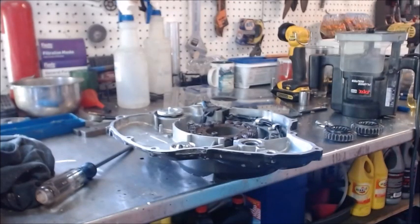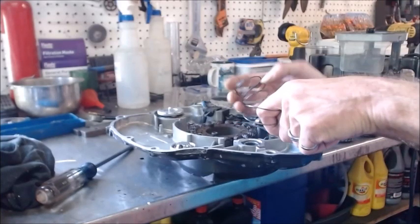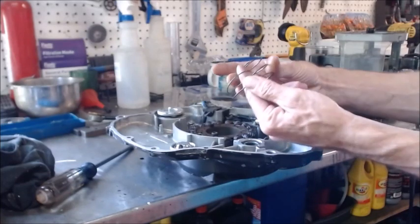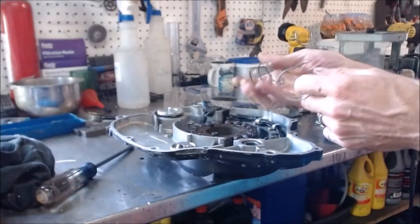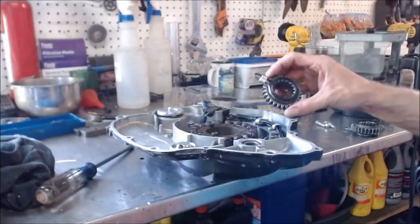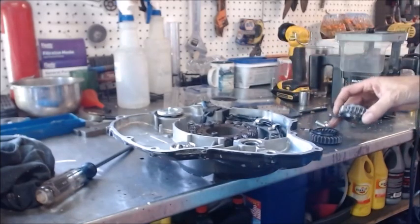All right, so we saw from those previous experiments that taking the spring and going from the full spring to a shorter spring, so cut, I don't know, a couple curls off that dog. So going to a shorter spring seemed to help just a little. Maybe it let it engage just a little further, not sure. But adding that little clip on there versus not having the clip, this is the old gear, not having the clip, that helped a bunch.